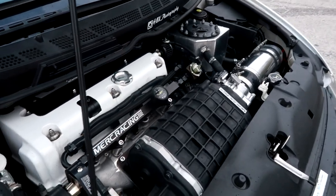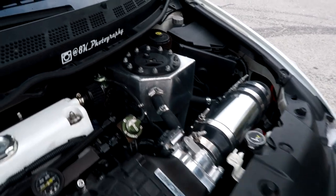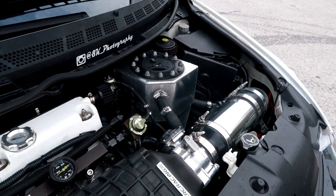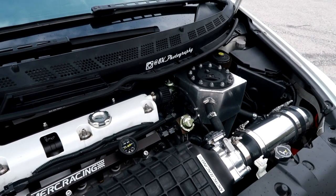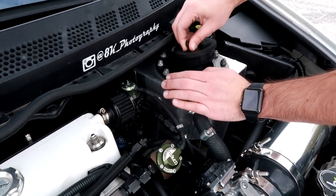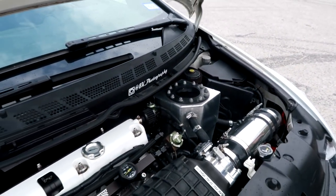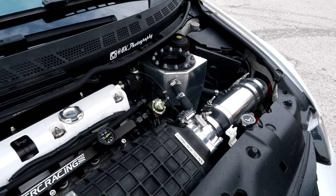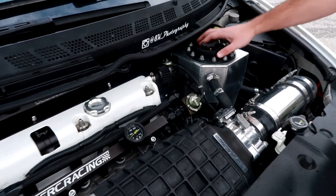I have the stock crank pulley with a 3.2-inch blower pulley. It spins around 14,500 RPM and makes 20–22 pounds of boost. I've got a J37 throttle body and a custom four-inch intake that I made. And there's the custom icebox — made for me by my tuner Derrick at IMW. That's been with me since my CT kit. I just do a straight water mixture in it; it doesn't get that cold here so I don't need antifreeze. There's a filter at the end of the pipe so if I put ice in it won't block the cooling system — it keeps IATs below ambient.